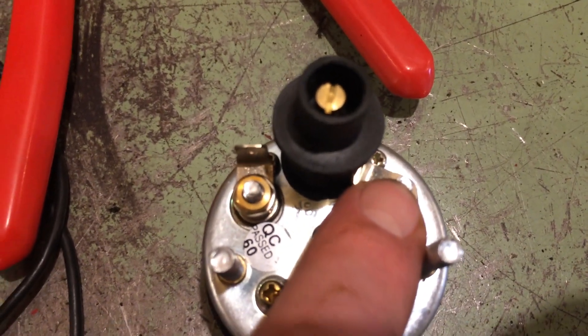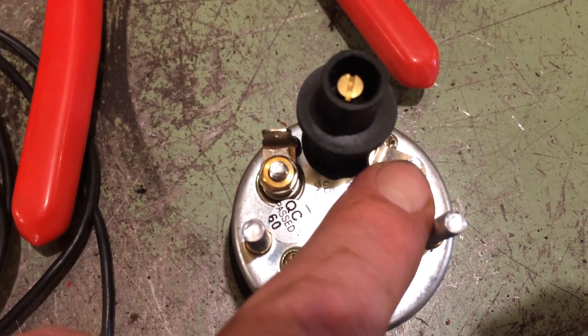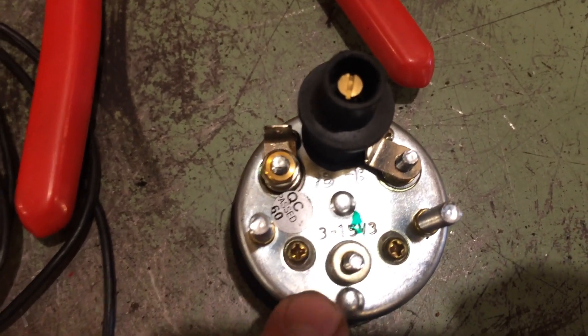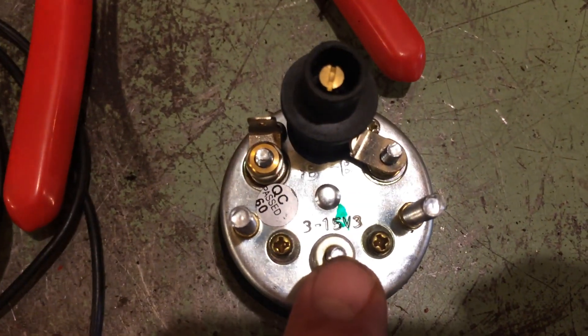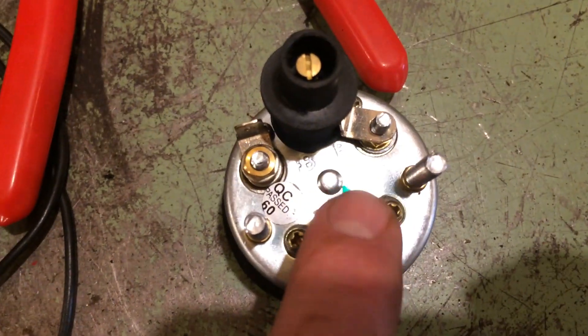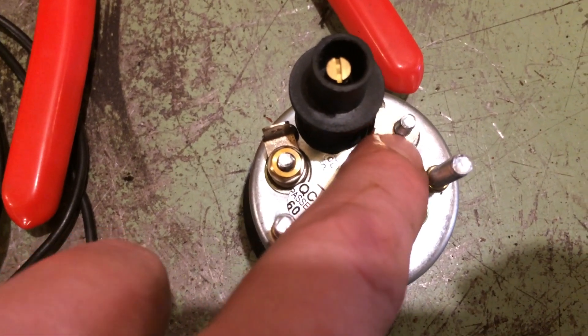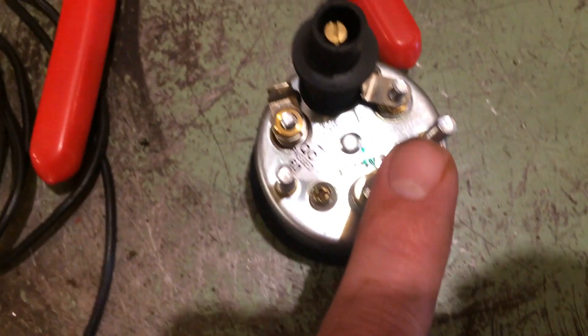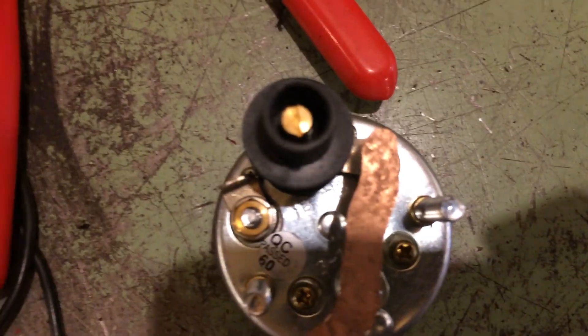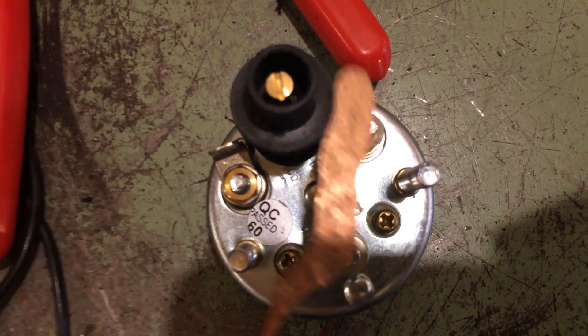This post is for negative battery ground. I don't want to rely on the dash to make a good contact and ground, so rather than running two wires to the battery for ground, I'm going to tie the two ground posts together. I was going to use a wire with a couple of ring terminals, but I can't get them to fit — we're talking three-quarters of an inch gap. So what I came up with: I've got an old piece of Romex, I pulled the ground wire out of it and just pounded it flat on my anvil. It's actually wide enough where I think I can drill it and make a strap to tie the two together.